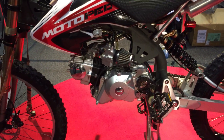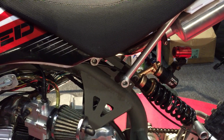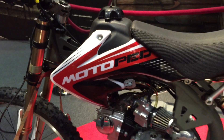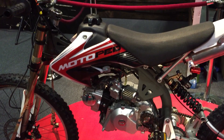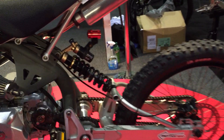The idea is that you have a kind of Honda Z50-type motor that hangs in the moped frame, and you can ride it like a bicycle or like a moped. When Cam designed it, he went with the CRF50-style mounting brackets because that motor is the most copied or cloned motor on the planet. That gave us and our consumers multiple options in terms of different motor setups, different sizes, and different manufacturers. You can run a factory Honda motor or any of the Chinese clone motors — various options at an extremely affordable price.